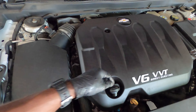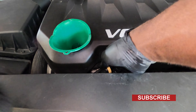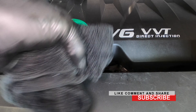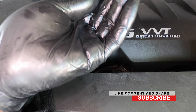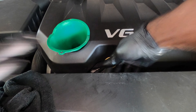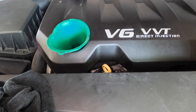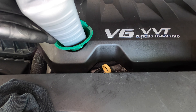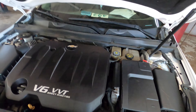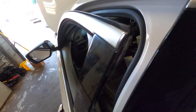Once you're done below, come on top and start adding oil to the vehicle. You want to add five quarts first, then check it — pull the dipstick out, wipe it off, then pull it out one more time. It looks like it could take another quart, so I've added five already and this will make six quarts. Six quarts is what it takes, so once you put six quarts it's gonna be at the correct level.